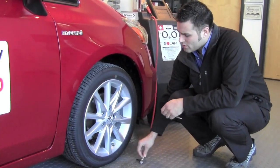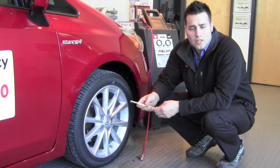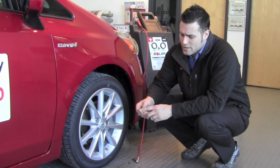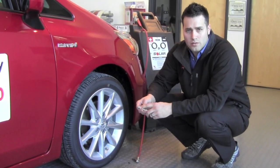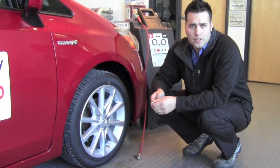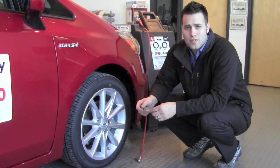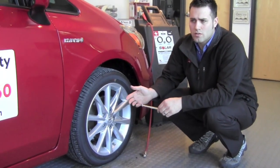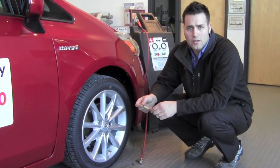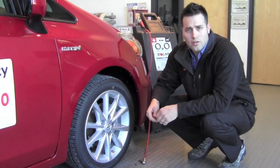Take it off, then recheck your tire pressure and make adjustments until you get it to 32 to 35 PSI. If you do get it too high, the back side of the tire pressure gauge has a little knob that you can use to let some air out until you reach the desired pressure. When you're doing all this, you'll want to have the key in the on position — that way you get direct results and can see the adjustments you're making so that light will shut off sooner.